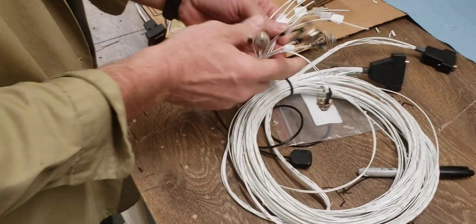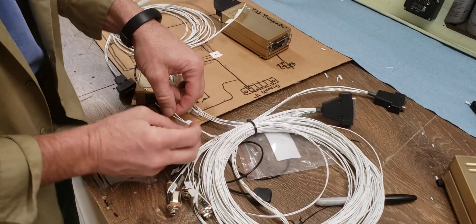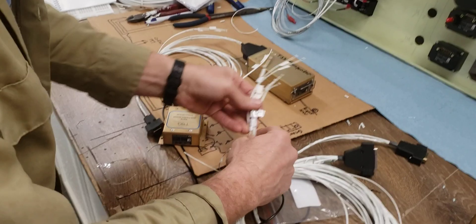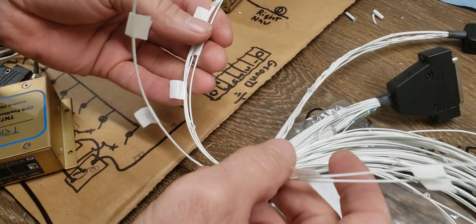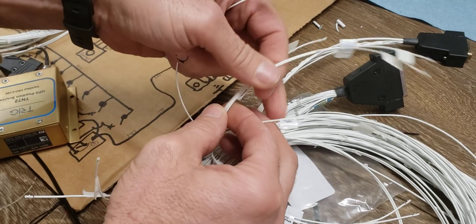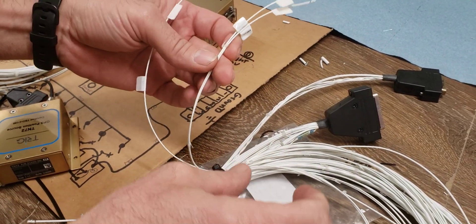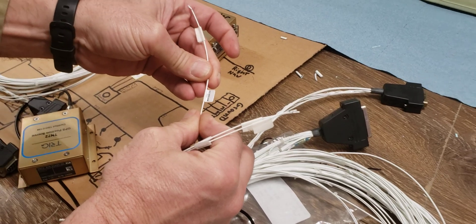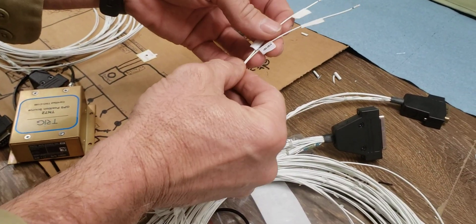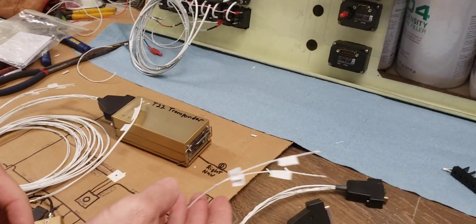They come pre-wired with all of your headsets and microphones and all that. You've got your two PTT wires — that's push to transmit to call tower or whatever. A couple of speaker wires if you want to hook up an external speaker. Ground wire. See how nicely they're labeled? Auxiliary in, so you can have warnings and those sorts of things. And that should be the intercom PTT. You can hook these two wires up — step key and transfer key — if you had a joystick and you don't want to reach over and change the radio, you can activate it with that. I may hook them up, I don't know.